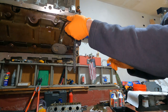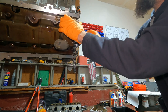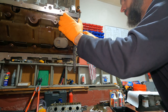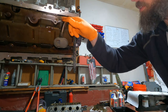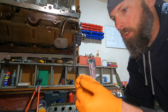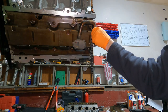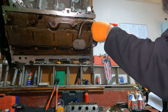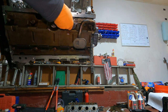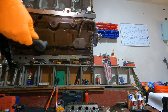Going to shove the pickup tube up in there — just start it and try to get it aligned. It requires a little bit of pressure, so wiggle it and we're in. I'll start that nut with some blue Loctite — that's a 13mm — and the bolt is a 10mm. Sprayed these down with brake cleaner to get any foreign debris off. Just snug them down nice; we don't want to go too crazy on these.